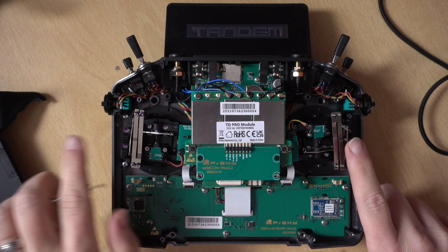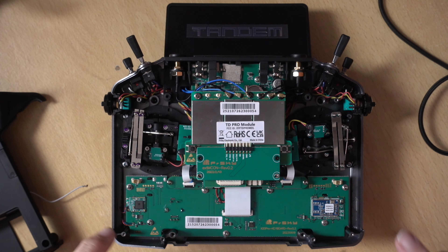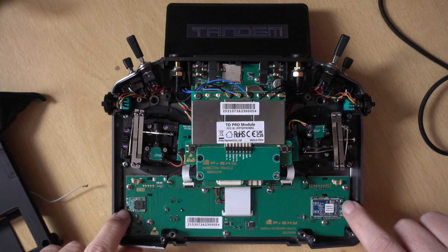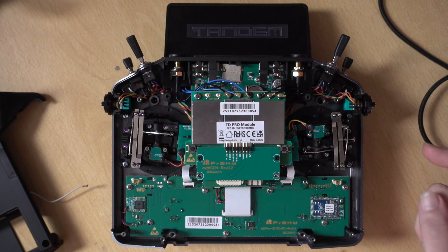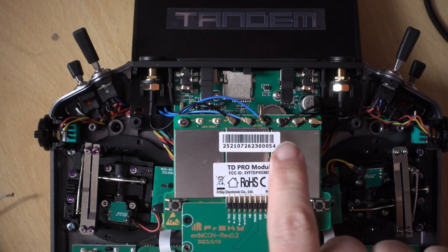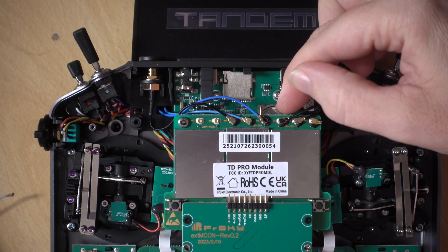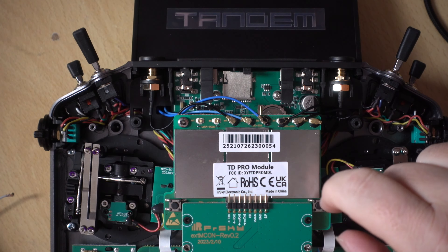Anything else you can just do with the black plastic cover still in place, which I would highly recommend, because these are the two Bluetooth modules here and you can see they have very tiny antenna connectors. So when you do take the black plastic off be very, very careful of that. To take the side grips off there are two plugs which I'll show you when I put it back together. First of all, as I mentioned, there's a real-time clock battery located here, so if you need to change that you will need to take that off — you may even need to take these two boards off as well.